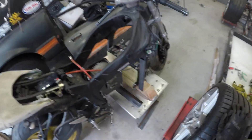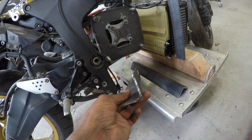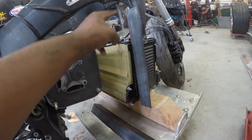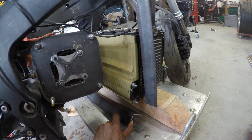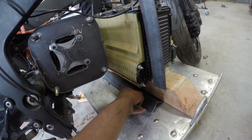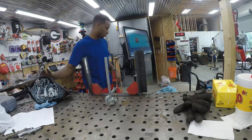Next step: let's get these batteries mounted into the frame. Starting out with three pieces of angle steel. We have these three pieces of angle iron — one is the length of the bottom of the motor, and the other goes from the bottom of the battery to the top of the mounting point. All I want to do is make a square frame here that mounts there. These pieces will be welded to each other and then I'm going to connect this square to the bottom of my motor plate, which is a structural member.